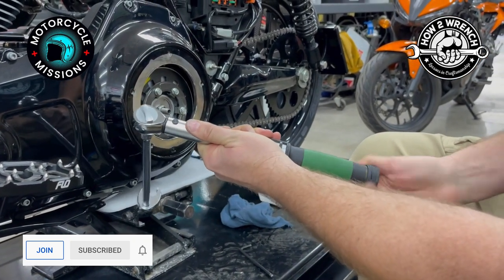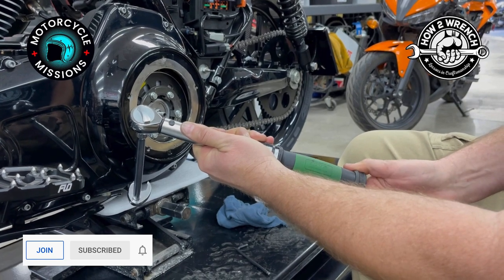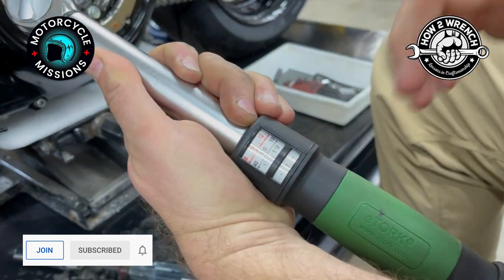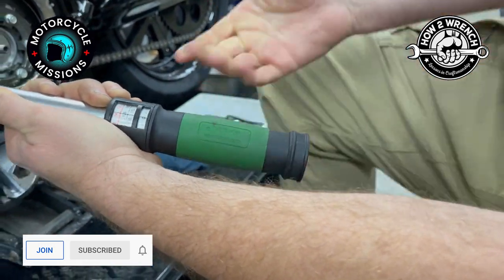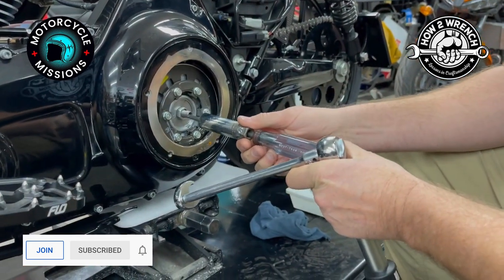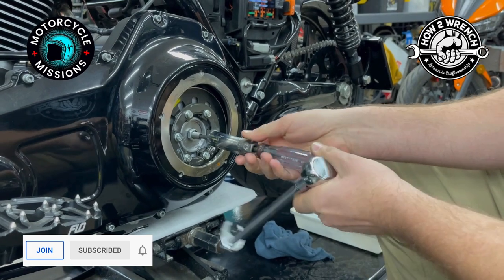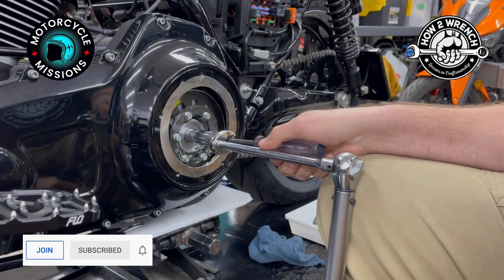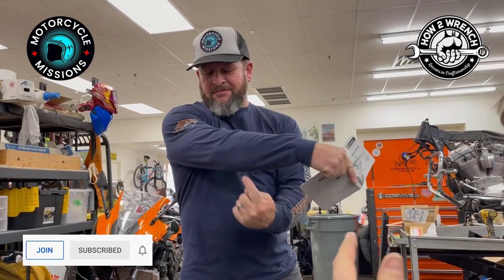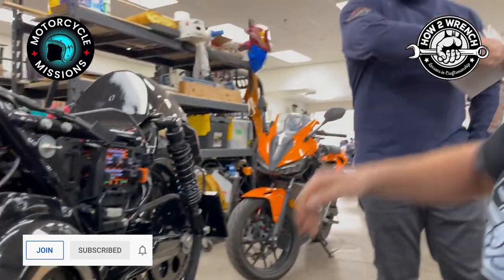Then I'll go up to 120. I love the gauges on these torque wrenches — I didn't show this earlier, but check this out: it's got a lock so you can't move it. Notice how I pull the crow's foot back each time to make sure I'm seated. It would be so easy to be above it, have it bottom out, and end up not holding it properly. So going in with the special tool, getting all my body language in place — and we got a little movement out of it. The elbow click was at 72, and it moved at 120, so it was somewhere between 72 and 120 inch pounds. That's fun stuff.